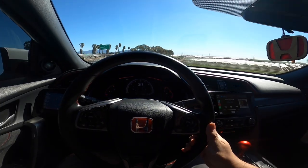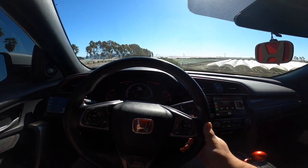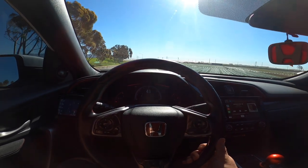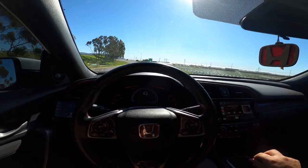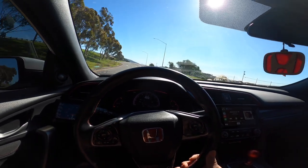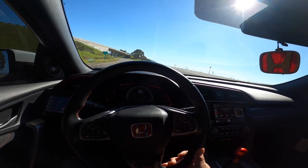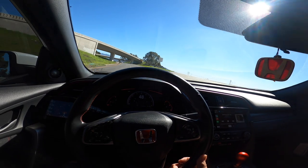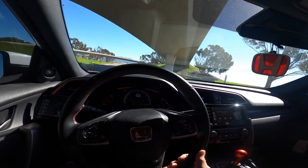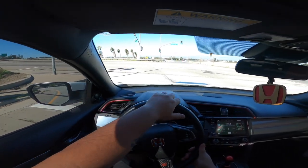So one thing that he recommends is for when you guys are doing your e-tunes, pick a route. Consistently use that route every time you use your e-tune. That way you get the same results. So I'm gonna be using this route the entire time when I am e-tuning, and I'm just gonna be cruising it right now. I did time it, so I think I'm gonna hit the end of this highway in about maybe 7 or 8 minutes. I'm just gonna do a U-turn and double back. All right, well, I already started the log.